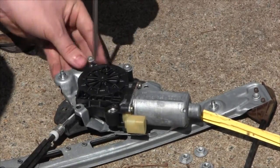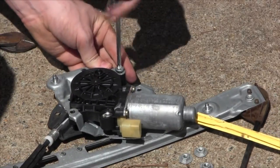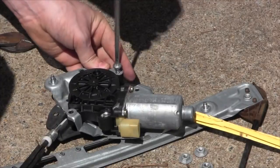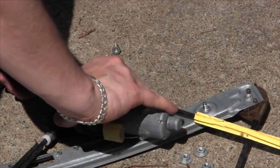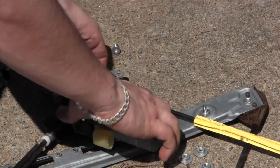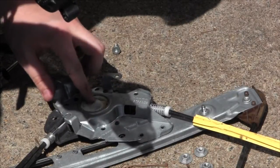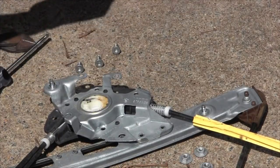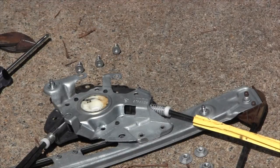After you take these screws off, the motor simply pulls straight up and away from the assembly. You got to twist it. Well, you gotta twist it. How's that gear look? That's fine. Okay, so it's plastic gears that drive this. One of the things you want to look at is make sure that the teeth of those plastic gears aren't